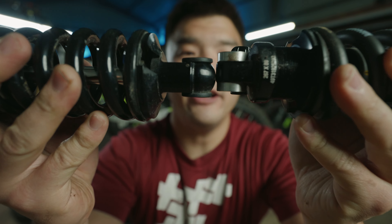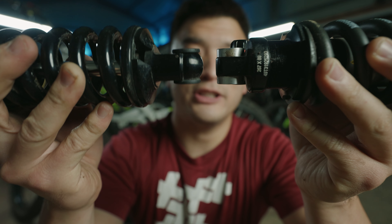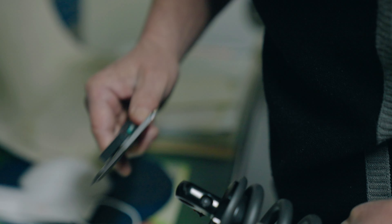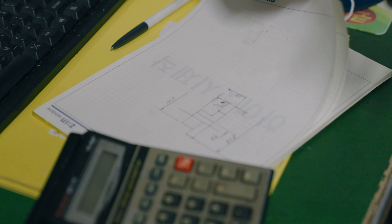I was actually looking to buy a Fox VHX shock but couldn't find one online, so I got the Vivid. Now swapping the shock isn't as simple as taking the stock shock out and dropping in the new one. When I first tried to just bolt everything in, I noticed that the sizing of the tabs on the shock are very different. The thickness of the tabs are different. I custom made aluminum hardware to fit the Suron. Before you begin, you have to get a lot of measurements of the original shock and the new shock to accommodate the difference.